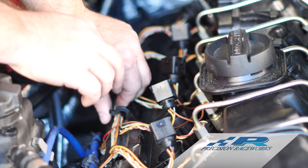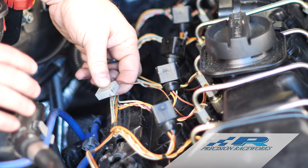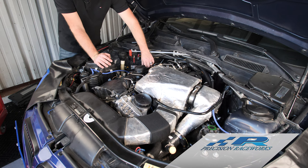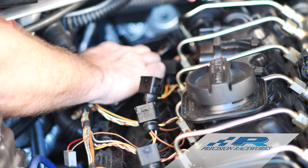Come across here and start by removing the wiring that's just clipped in on top. Remove each one of those. You've got a capacitor that's built right into the system from BMW. Some other coils — Okada and others — try to claim their upgraded harness puts out more power, but really all their upgraded harness is, is a harness with a capacitor. BMW already does that, so save yourself some money — you've already got what you need built into the car from the factory.